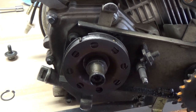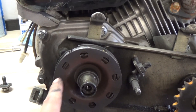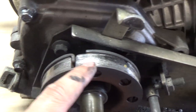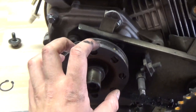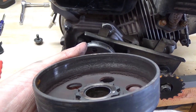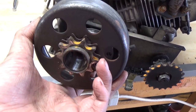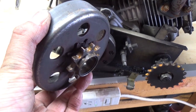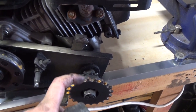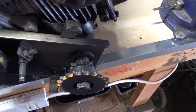This is a good time to show you how a centrifugal clutch works. It just goes by centrifugal force — as the engine generates motion, these little pads extend outwards and grab to the inside of this little drum here, which then transfers power from the engine to this hub with your sprocket hooked to it. That transfers power via a chain to this sprocket, and with a little gear reduction here from the jack shaft, transfers power from this sprocket back to the sprocket on the rear tire.